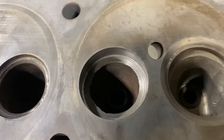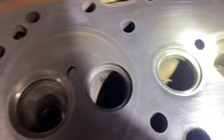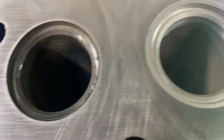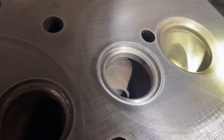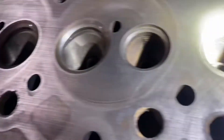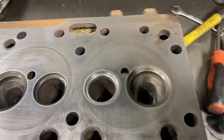Got our seat drove home — came out absolutely beautiful, right flush with the deck, just like it's supposed to be. Turned out great. We'll go ahead and grind the seats in this old girl and check the valve height, and out the door she'll go.